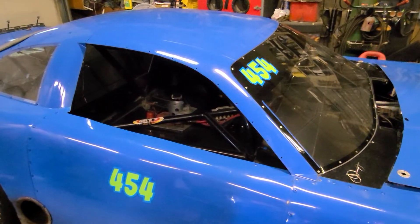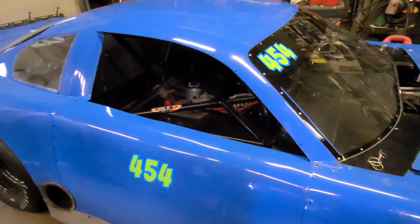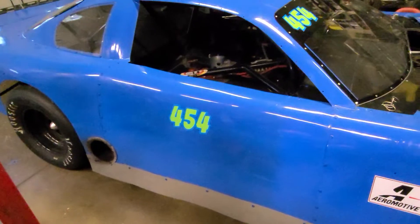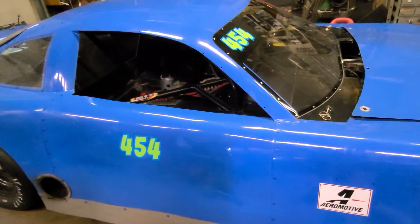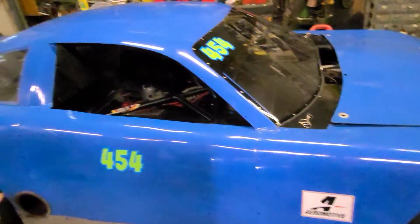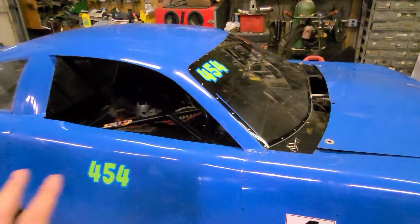I'm still kind of torn. The car was decently quick, but I was having to drive it a lot. It had that push and was definitely a little bit loose off of four. So I made a few more changes to try to fix the loose and the push, which you're kind of fighting against themselves. The way I like to look at it is the loose was in the back of the car, the push was in the front, so try to separate them that way.